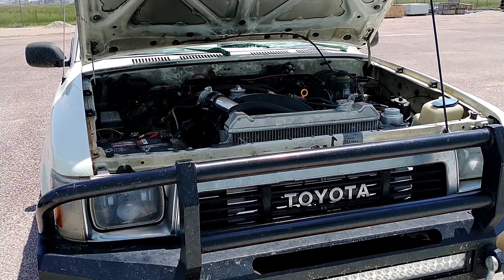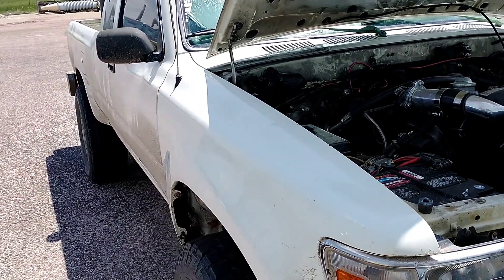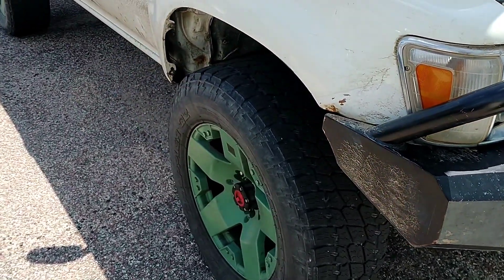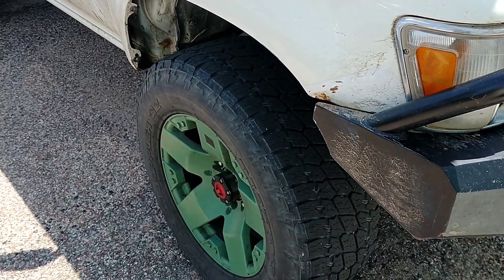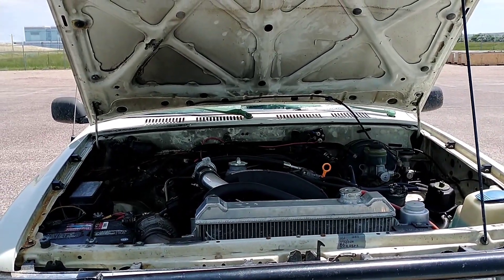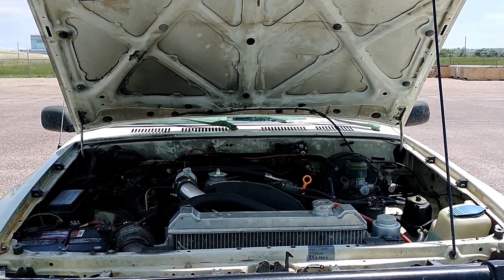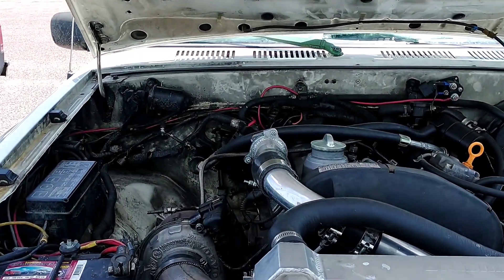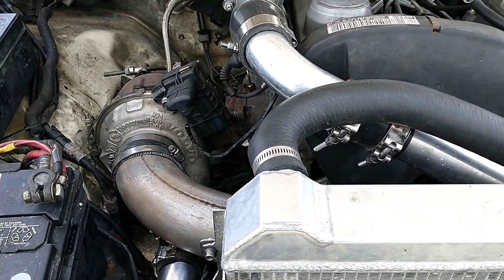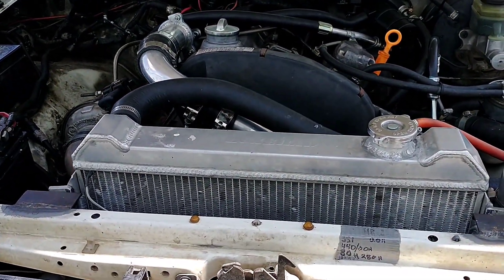The truck is pretty well original behind the engine — nothing's been changed. It's running 410 gears from the V6 and these are about 32.5-inch tall tires — 285/65/18 in metric. You guys can go back and check out other videos on the swap and see how it's come together. It's been about two years now and I could not be happier with this turbo. It's performing even better than I expected. It is a pretty rare turbo though, so I'll probably stick with a 2056-style for other builds since they're so much easier to come by. Thanks for watching.